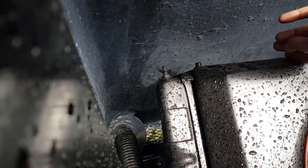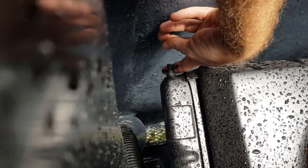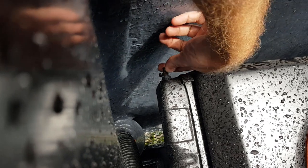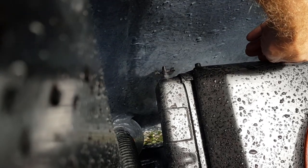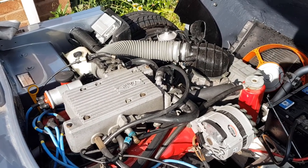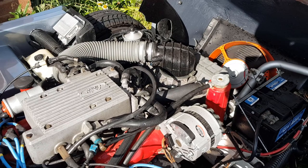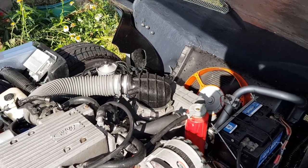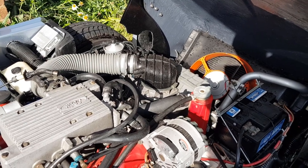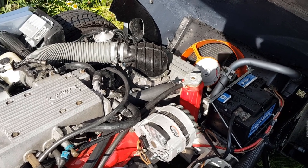One of the things you'll need to do is bleed the radiator. On top of the radiator there's a bleed screw — just open it up, start it up and get that to flow out. The heater's running nice and hot, all the pipes are hot including the top ones. Just keep topping up that swirl pot, bleed off the radiator over there, rev the engine a little, and it'll eventually come right for you. Only took about 10 minutes to bleed.